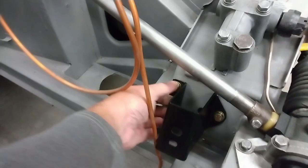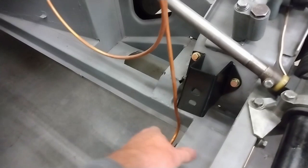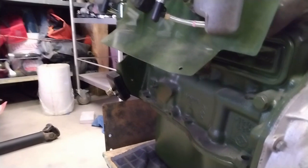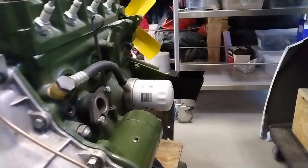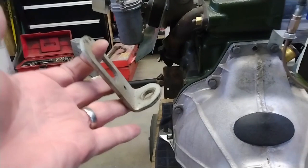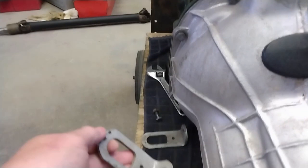So here you can see I've got the left side mount installed and it's in here loose, so there's still some room for movement. I'm going to have to do some adjustments on this fuel line at some point because it's going to interfere here, so I might just cut it back somewhere along here and hook the rubber line down here and bring it up to the carbs from that — but I'll get to that a bit later. Motor mount loosely in place on the left hand side of the engine, and on the right hand side too. Next up I'm going to remove the shift lever from the back of the gearbox because that won't fit down the tunnel with it in place, and then I'll put on the mounting hooks, get the engine crane set up, and start to swing the engine into place.